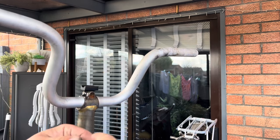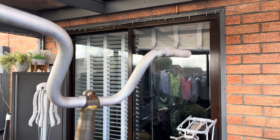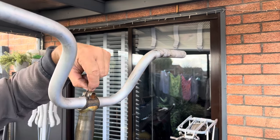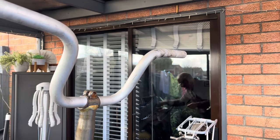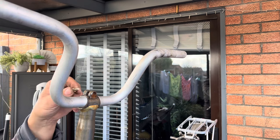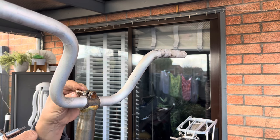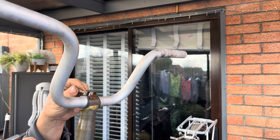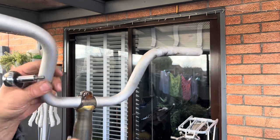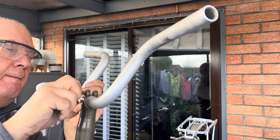This area — where the stem holds the handlebar — has a little bit of an issue with rust, as you can see on the bolt I've removed. A tip for removing the handlebars: once you've taken the bolt out, put it back in the other way, thread it through against a washer so it doesn't go back through the hole, then turn it a turn or two against that. It will open the stem up a little and make it easier to get the handlebar out.